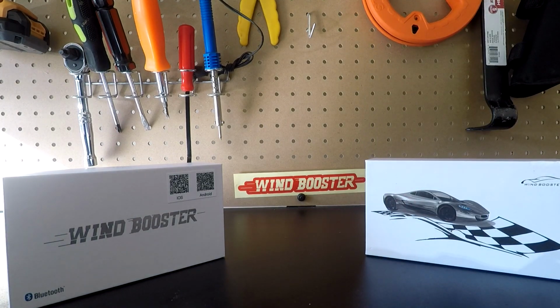Basically, when you think of throttle controllers, think of your more well-known ones like pedal commanders. What this does is it alters the ratio from how much you press your acceleration to how much throttle you get in response. So for cars that have a little bit of lag, when you put these on specific modes and change the levels, you're altering the ratio of how much pedal you have to give before the throttle is fully open, if that makes any sense.